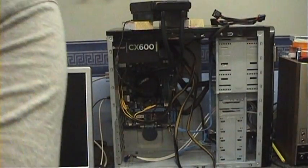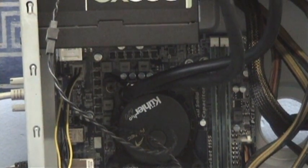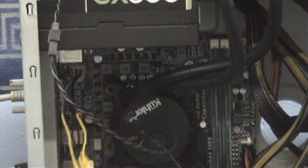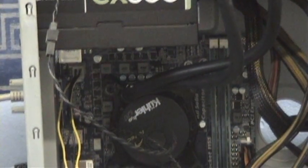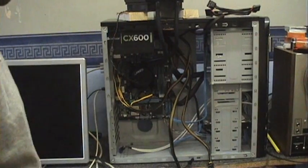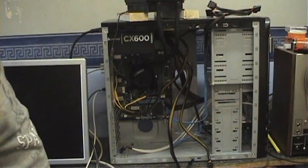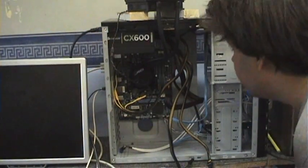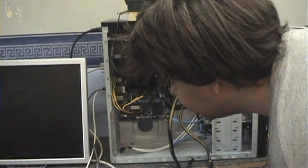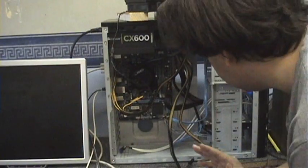A little bit of innovation there — I've spliced one of the leads I'm not going to use from the power supply. I've got an ATX connector from the old power supply that was in this computer before and I've plugged that in there. So hopefully now that's all plugged in it should work. I don't really want to have to splice the leads from the power supply. Anyway, let's plug in and turn on — let's see what we get now. I think it's staying on. Can't see anything on the screen but it's definitely showing signs of life.